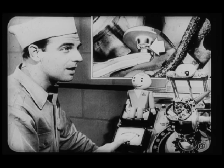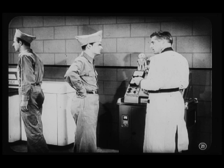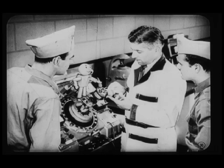That's our trouble. Look, why don't you go get a new set of points, Lou, and we'll replace this breaker set. Breaker set? Don't we have to replace both sets? Nope. It's only necessary to change the burned ones. Now, while Lou's getting a new point, I'll take this old set out and be all ready. Well, that does it, boys. New set's all in, ready to be tested.